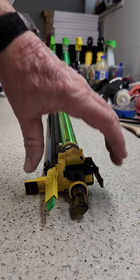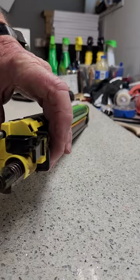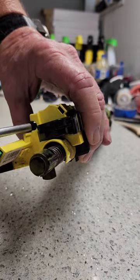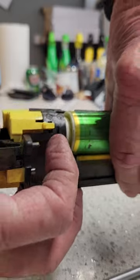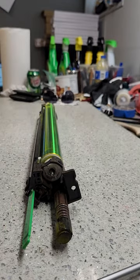We're going to change the drum in a 55 series. First, take the screw out that's in front of the drum unit cap, whatever color that may be. You've got two clips — use your finger to slide it off. This can be used on any color at all.